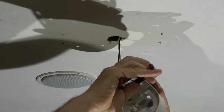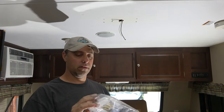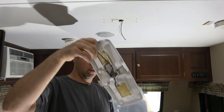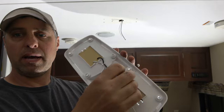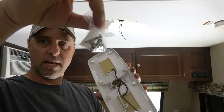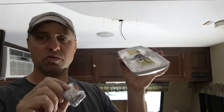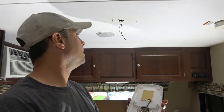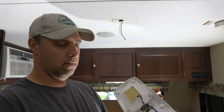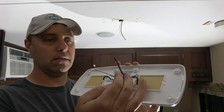Snip it right there — remove. Here's the new light; there's really not much to it. On the back side it just comes with a little pack of screws to attach to the ceiling. There are eight holes in here — eight screws — and these things are super light, so if you don't want to use all screws you really don't have to, depending on how many holes you want to put in your new camper. This comes with two pigtails: the white one's labeled ground and the black is the positive.